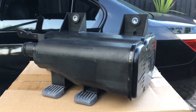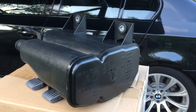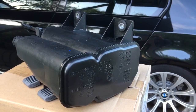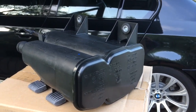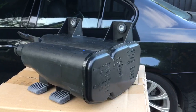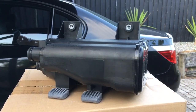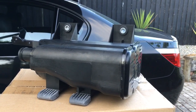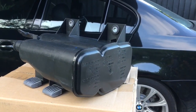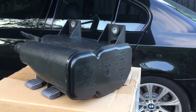What can happen over time is the filter can become blocked, especially if it's been exposed to liquid petrol — like if you've topped off your tank too much and it's overspilled into the charcoal canister. Or it can just become blocked over time. This thing is 15 years old now. When it becomes blocked, it'll cause your fuel tank to be unable to breathe. As the fuel level reduces while driving, it'll start creating a vacuum in the top of the tank.